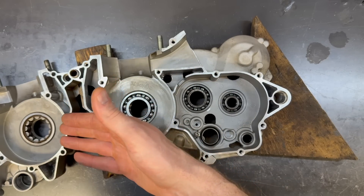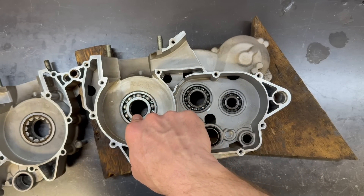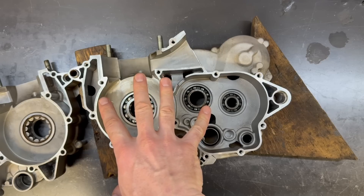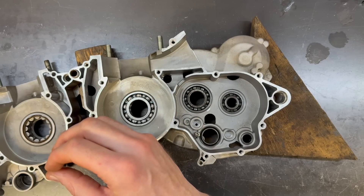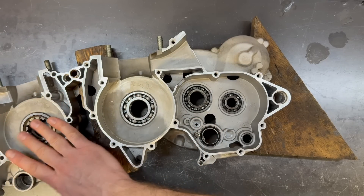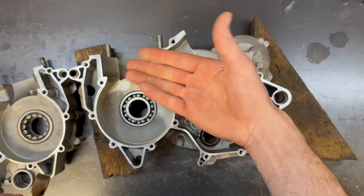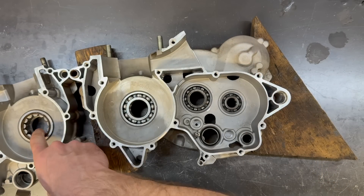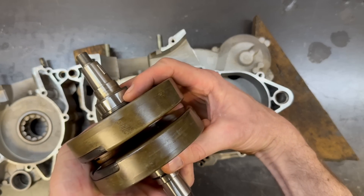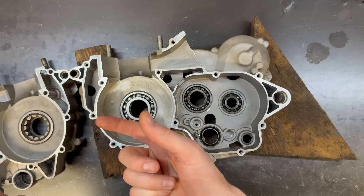Now, it is possible to alleviate that side load. What I personally do is install the crank into the right case half, then I heat that bearing and drop it on, and then I can relieve the side load if there is any with a drift or by vibrating the crankshaft or bearing assembly. The reason why this upgrade is effective is because this side is a slip fit. I can put the nut on the other side — this side, obviously, is a slip fit. So as long as the crank isn't physically wider than what the crank cases can accommodate, there is no way to side load the bearings at all.